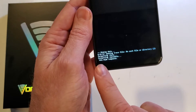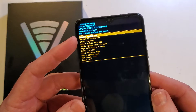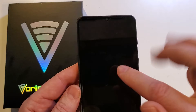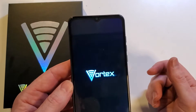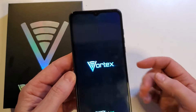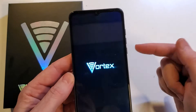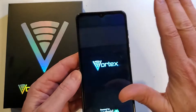We're going to wait for the data wipe to be complete. It could take a few seconds, or if you use your phone a lot, it could be many minutes. Now it is safe to reboot the system. Remember that if you've set up your phone with your Google or Gmail account, especially if you've turned on the find my device security, you will 100% need your Google and Gmail account to get back into the phone. All we've done is erase the screen lock.